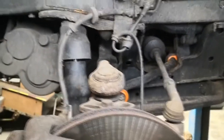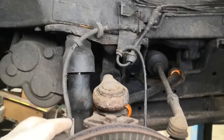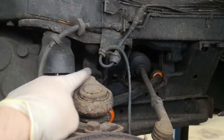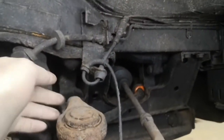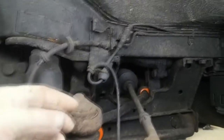Another video on the T4 today. I'm going to be doing the inner CV boot, and how I'm going to start off is taking the M12 spline bolt out of the inside. I'm going to use an M12 with a few extensions to bring it out to here, and then it's nice and easy to work with.